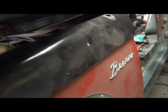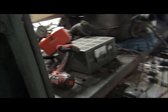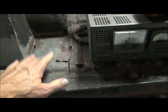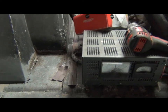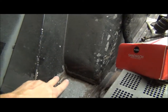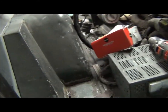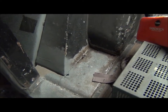I've got all the holes drilled in this front edge so I can plug weld it up and down through there. I'm waiting on a delivery, so I might spend this time to go ahead and cut that corner out. I've got a new one of those coming — I can get this metal replaced in here, get it all cleaned up ready for the new one. I also have a new front inner wheel tub coming, so I can go ahead and get the old one out to stay busy.